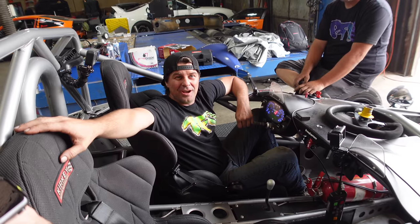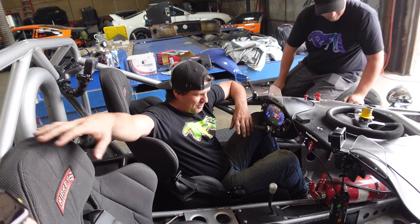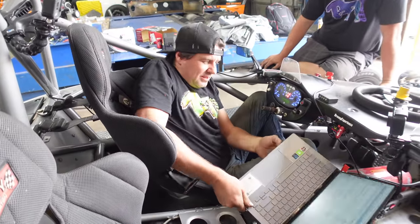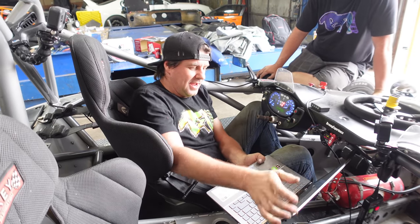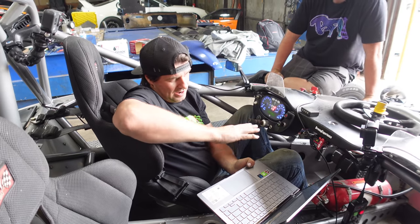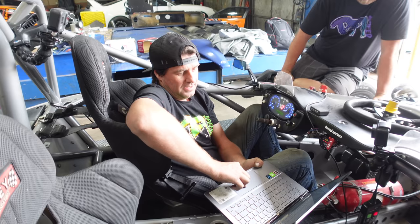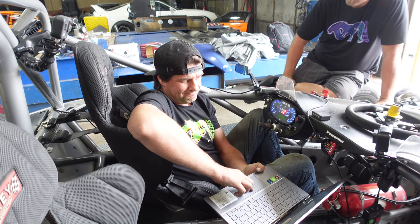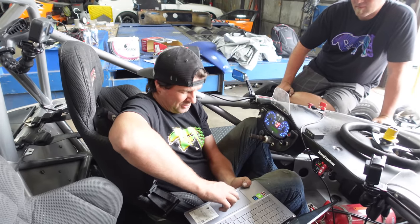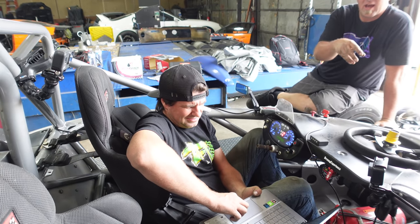Insane, that is wild. Both sensors are working good? They're both holding up. This one is the one I've been watching under full throttle. Now, light throttle, they both match and the correction's all good. Under full throttle, this one pigs out, and that one says cool, so I'm basing off that one. It's just the visual gauge that makes you trust it. I've done so many with this style that we use that on everything.